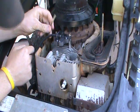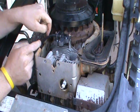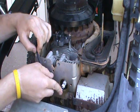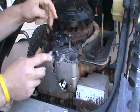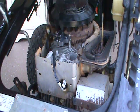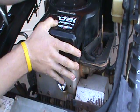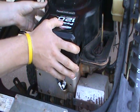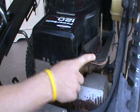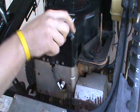Two things left to do: remember that wire you took off the magneto - you need to plug that in, which you can do before or after connecting the bolts. Take your wire and make sure it comes back through this little groove here, connect it to your spark plug, and you can cut off any excess to shorten the cable. Then put your engine cover back on, put your bolts in on every side, put the air filter back on, fire it up, and you should have spark. That should solve your problem. Thanks for watching, subscribe, leave a comment below.